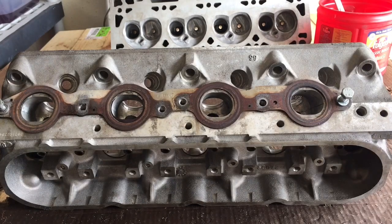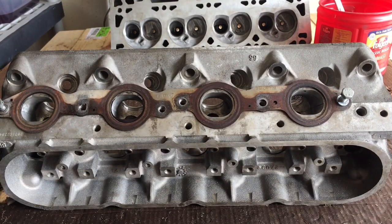If you look at this objectively and think about efficiency of flow without reversion, tumbling, or any impedance, then you'll understand the logic and the physics that I'm going to try to explain to you. I do this modification as well, but you need to be super careful making this hole bigger than the exhaust manifold or header opening that you're going to bolt to this cylinder head.